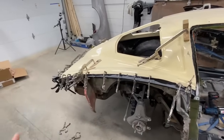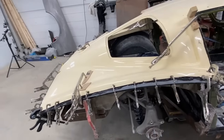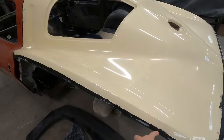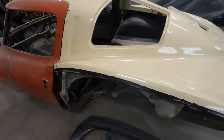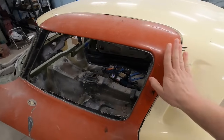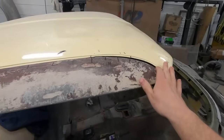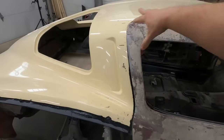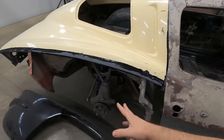Those are the next hurdle. We're going to install wider quarter panels from Dynamic Corvette, so we have to go ahead and delete the original splash shield here, and we have some bigger splash shields to take that place that'll fit the curvature of the new quarter panels better. I removed all the clamps, and you can see everything looks really nice. I have to remove some of the extra bonding adhesive that got on the bonding strips as well as on the rear deck, and I also need to come through here with the DA and just shine all that up, remove all the extra flashing. The doors fit up nice — they don't close all the way because there's some extra glue and flashing, especially up front. So I need to refine that to get the doors to close fully, and then we can start to get the quarter panels to fit. The same is true on the passenger side — it's a little tight right in here, and there's a big gap right here. As the door closes, these gaps will tighten up. I just need to start removing some of the adhesive to get this door to fully latch without rubbing on any of these surfaces, and then we can start to get this quarter panel mocked up.